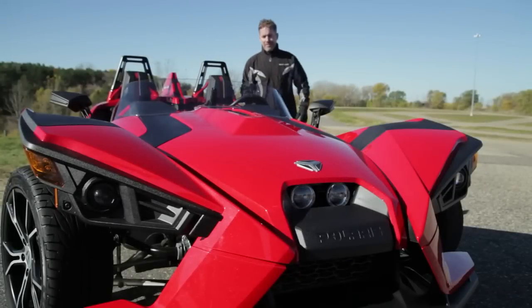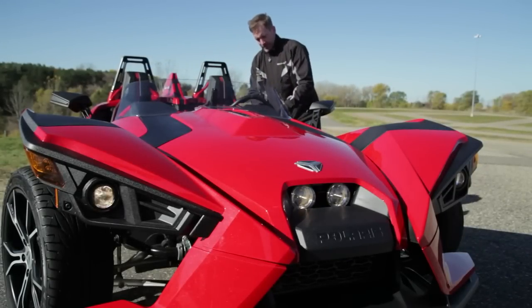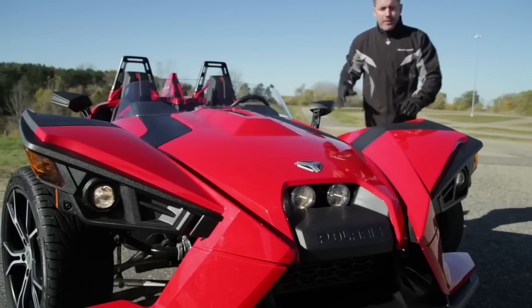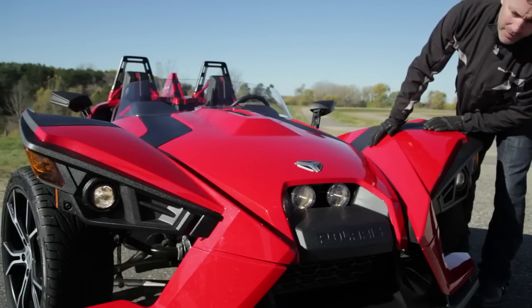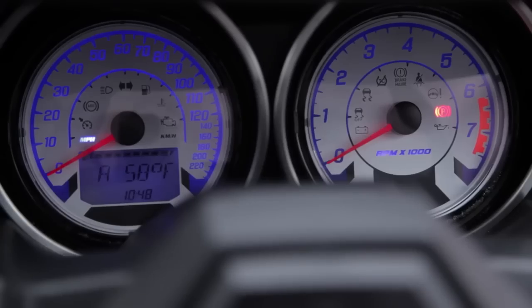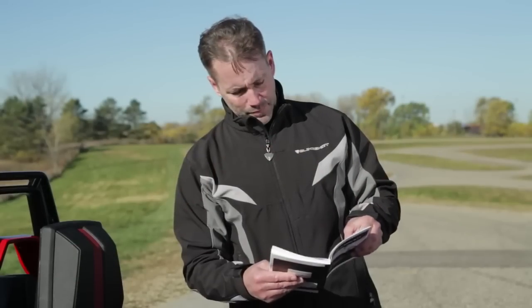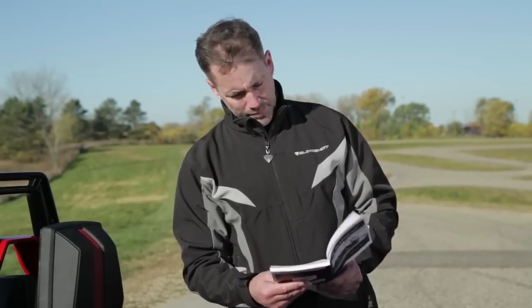Begin by inspecting the electrical components. With the ignition key on, verify that the headlights, auxiliary lights, and park lamps illuminate. Switch the headlights to high beam and verify that the high beam indicator comes on. Also, verify that the headlamp brightness increases. If adjustment to the headlight aim is necessary, refer to your owner's manual for the procedure.